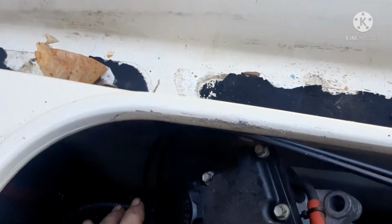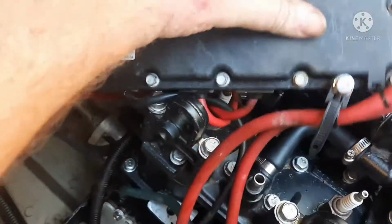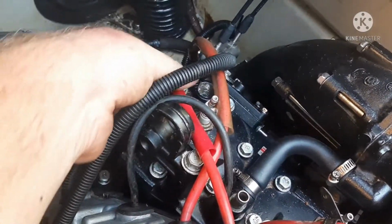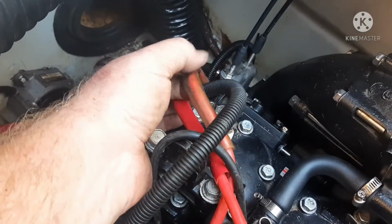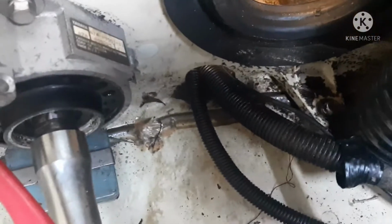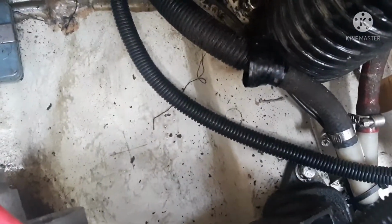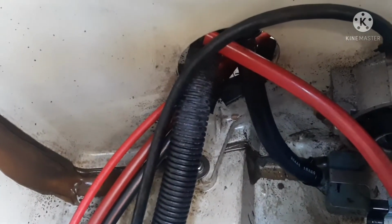You've got the 2 wires obviously for your cylinders, self-explanatory by length. But here on the bottom you've got a battery wire and a wire that goes to your starter. The difference is the battery wire has a red covering on it. The starter wire has a clear covering on it, and it also has some of this as it gets down next to the engine. The ground wire runs through that small hole right there, and you can see it's wrapped in the electrical protector. And then the battery hot lead runs through that hole right there.